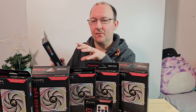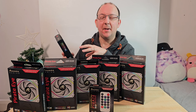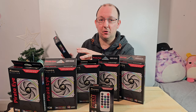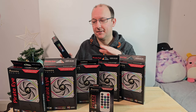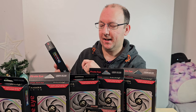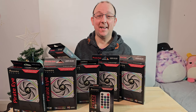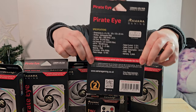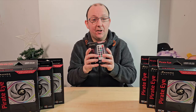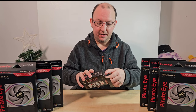This is where you can't use it without the hub - you have to have the hub. It's a six-pin PWM connector. You can connect one of the standard four-pin connectors to your motherboard like you would normally, and it will control all the fans, but it's all or nothing - you can't control individual fans. They're 12-volt DC rated as most fans are. It does have a two-year warranty, and as you can see it says this product must be paired with a Pirate controller fan hub.